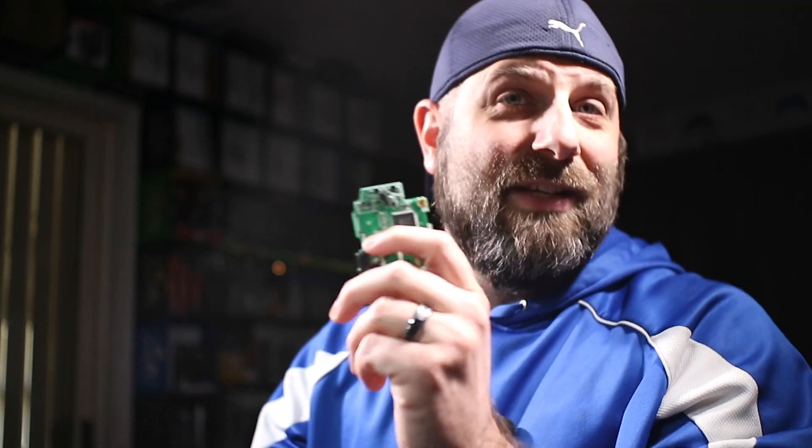There are a couple of things to go over. First, certain consoles like the Nintendo Switch allow you to recalibrate the controller. Another option: if you have a faulty old controller board, you can de-solder the thumbsticks and replace them. These thumbsticks are a dime a dozen — you can pick up a package of six or eight on Amazon. I'll leave links in the description below.